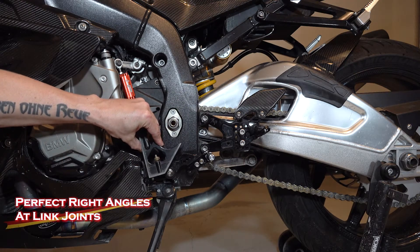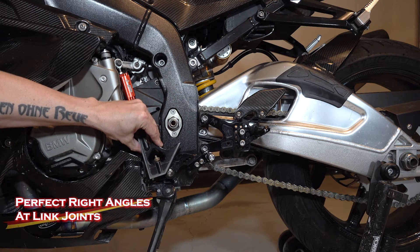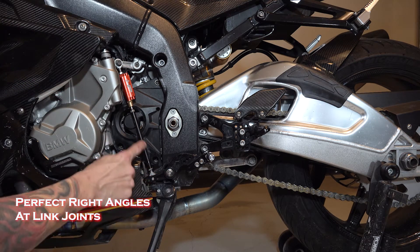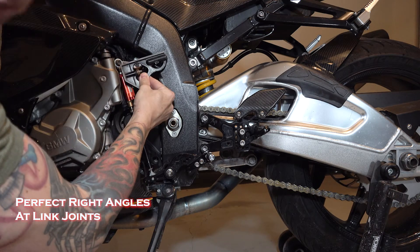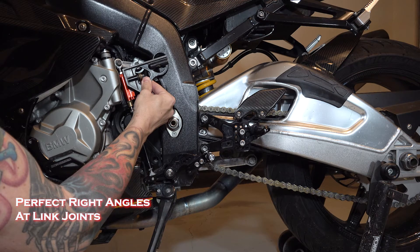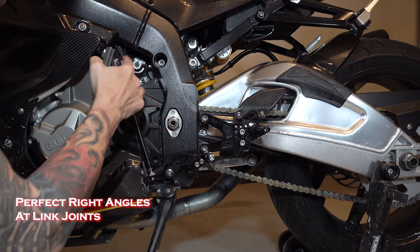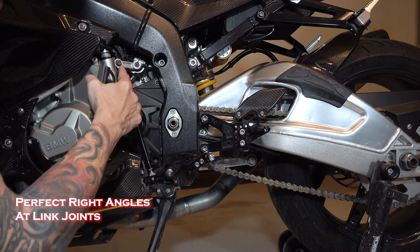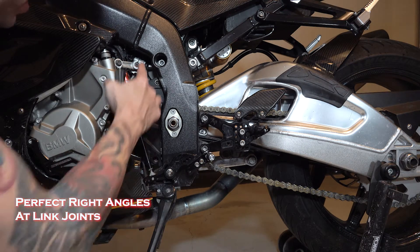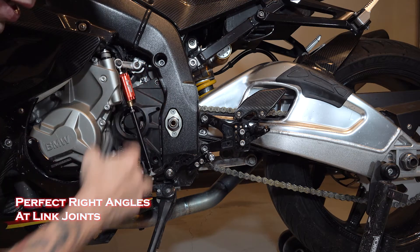If we look down here, that's actually pretty close to 90 degrees. That looks good on this angle between the shift link and that linkage there. Up here though, we see that it's angled a little bit differently. We may be limited in our ability to move this, but we can try and see if we can get it down a tooth or so — maybe that will make it engage at a more 90-degree angle.